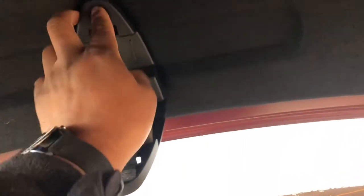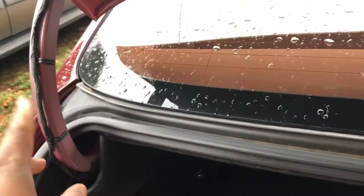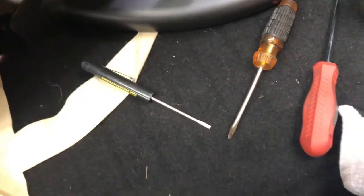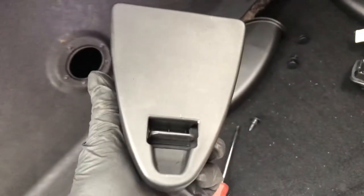This is already loose, I just gotta finish taking it out. That goes for the cover for the railing for the smart front. Once I drop this I'm gonna pull this cover. I already jumped ahead and took the panel down. You're gonna need two 8mm or Phillips screws — take the screws out, which are these two right here. One right there, one of these hold this in underneath the bottom end of the trunk.